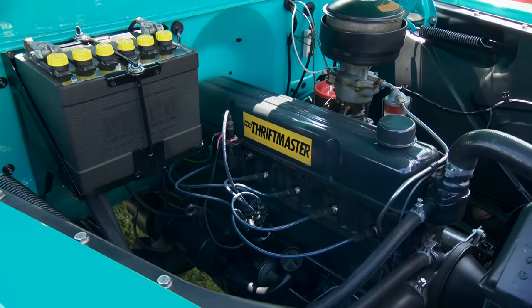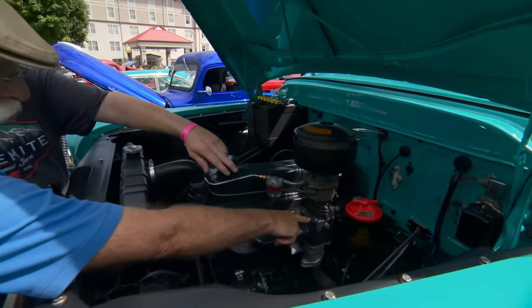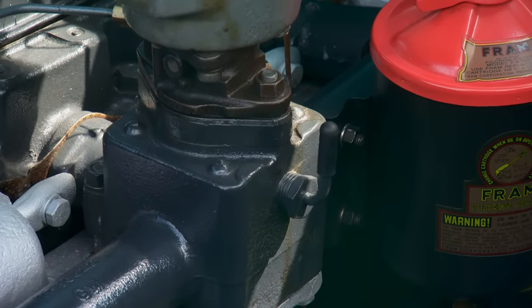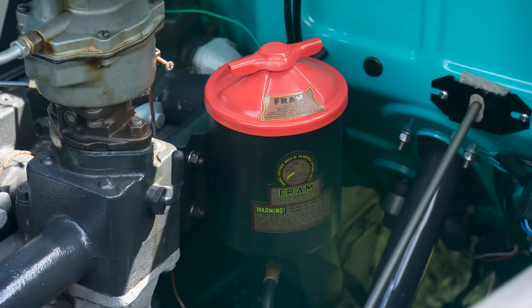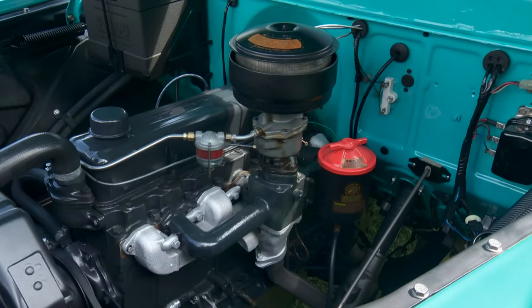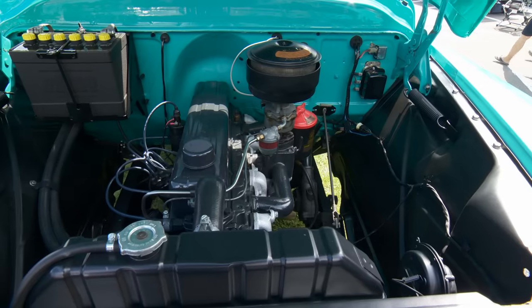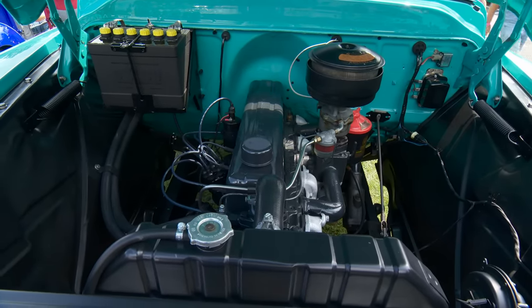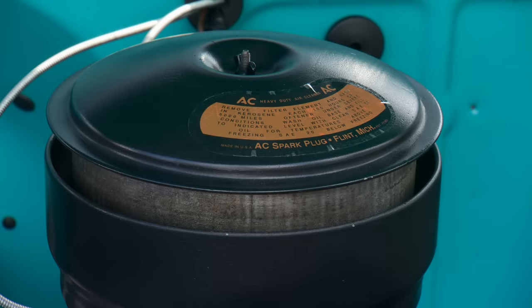That's a classic, isn't it? A 235. Correct — 235 inline six. It's got the single barrel, right? Correct. What's this thing over here? That would be for vacuum. In these years, you could have vacuum or electric wipers, and that would be the vacuum port. So it's capped off and you've got electric? It's capped off, right. This was the optional oil filter — they didn't come with one. And it's a bypass filter, so not even all the oil goes through it — only about 10%. You can see how thin those lines are. This actually lived on an Air Force base for most of its life — oil baths.